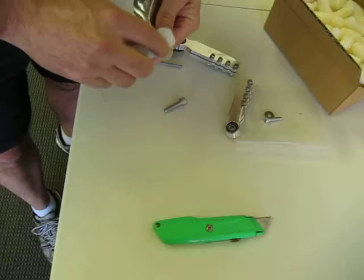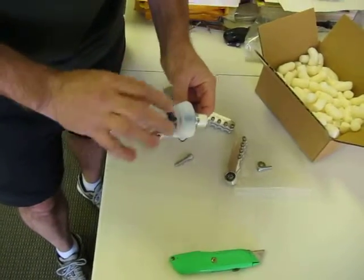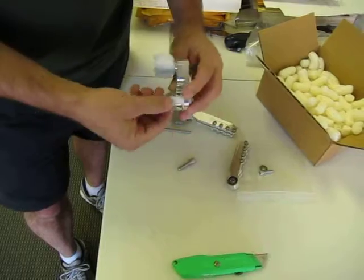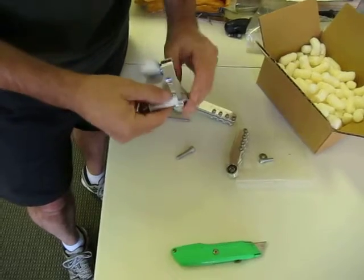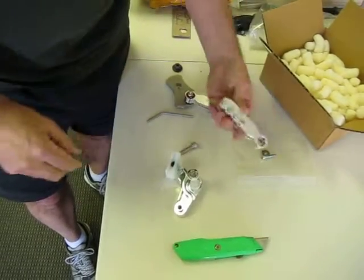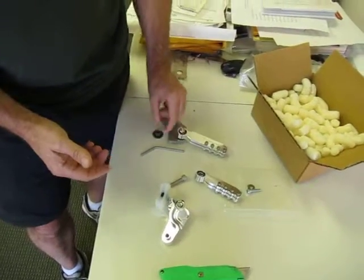This is the side to side bracket. This part here just goes on and off — it's held on when you install the shifter, it will never come off. Don't lose it. These bushings only come with certain shifters depending on which option you pick during your order process, so just pick the year model for your car and you'll get the right parts. And this is the cable end for the side to side. This is the whole kit for the Sigma 6 — that's it.